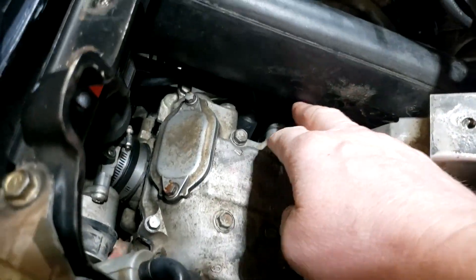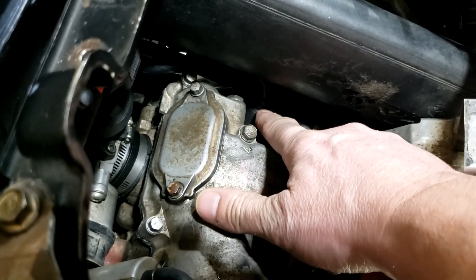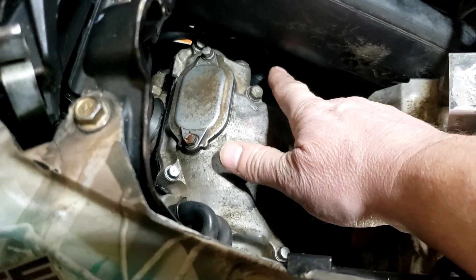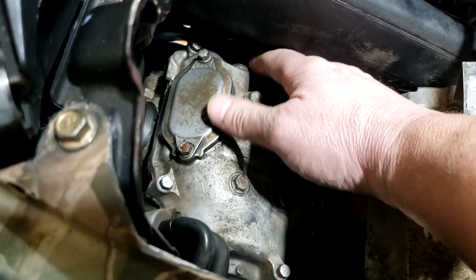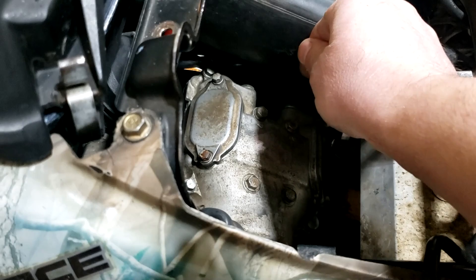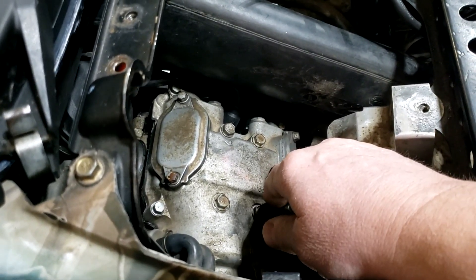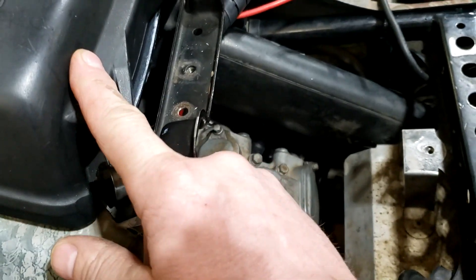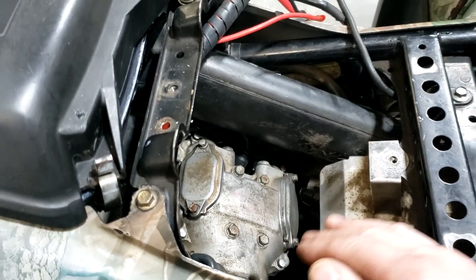If you can see in here, here's that air duct I was talking about — there's the spark plug cap. It's kind of a pain to get at. I can't tell if it's pushed all the way down; I think it is. But we're going to see if we can maybe force that over a bit, just to give me a little bit more room, because in order to take this off you have to take the air box totally out, sides off — it's a pain.